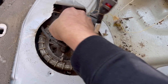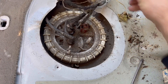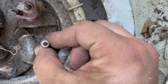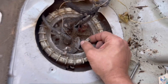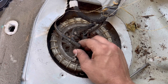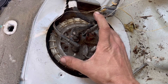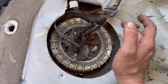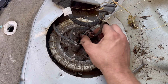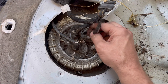This is the connector that goes straight down to the fuel pump itself. This is just a blocked-off fitting that doesn't go to anything. And then this is the single line that goes up to the front — there is no return line. It's self-returning inside the fuel pump assembly itself. I believe this is for the level sender, maybe.